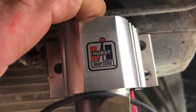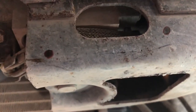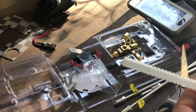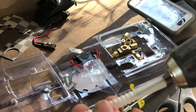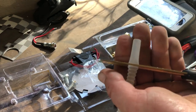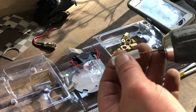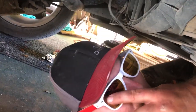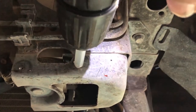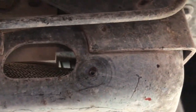Right here I'm showing you how to line it up — this is on the bottom of your anti-lock brake module. I'm marking it to show you where the marks are, right around the area I did it. I'm showing you a way that you can avoid drilling through the wiring behind that bracket. I'm using a slurpee straw as a countersink stop — you can see only a little bit can go through the metal. Now I'm hopping under the car with my safety glasses and drilling it.